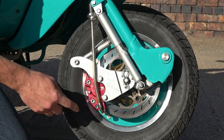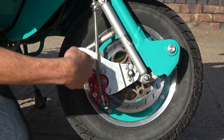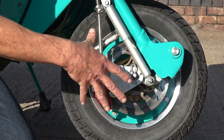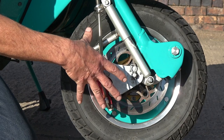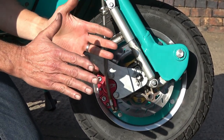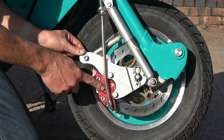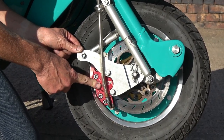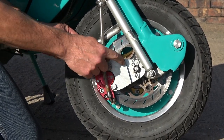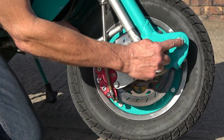The rim is held onto the wheel with a large disc which is suspended on a sprocket carrier that you would normally find on the back axle of a cart, and the components just slide on. That allows you to centralise the wheel and centralise the disc so it's in the best position for the caliper. On this occasion I'm using a caliper from SIP. I have plans to upgrade to a four-pot caliper but this two-pot caliper does very well indeed — you can see it has a mechanical anti-dive and the geometry looks about right.